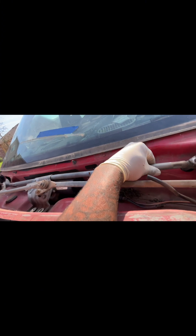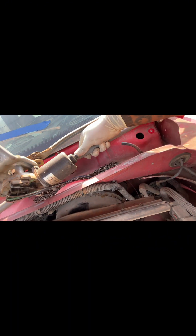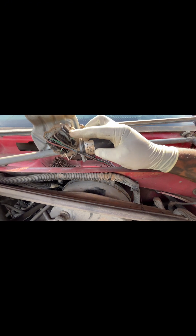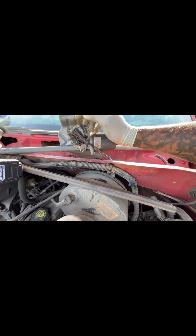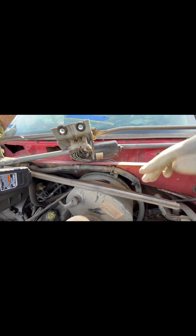At this point you should be able to just pull up — there's a grommet there — just like that. Pick it up and you see what I'm talking about: this connection right here. Go ahead and disconnect this harness from the body — this connector here and this connector here. This one's a bit tricky — you pop it like that, and there's a little spade connection where you need a small pick to push the metal tab in and pull it straight up. At this point I decided to go ahead and disconnect the negative battery terminal, since one of these might be a live wire.